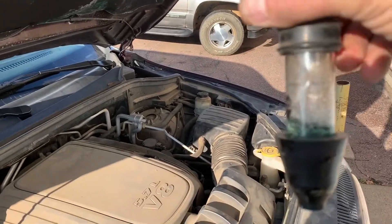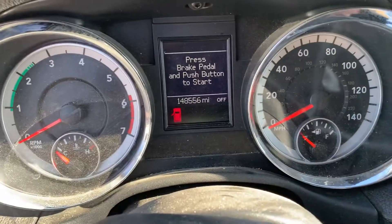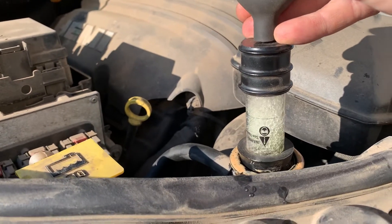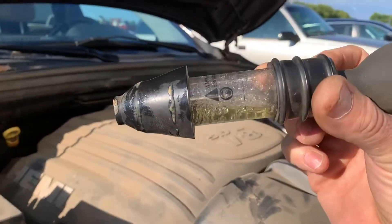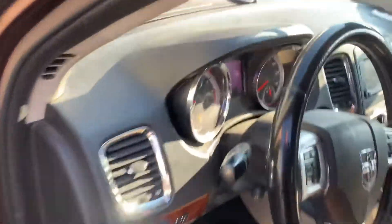That's turned an icky yellow — that's not good. We're going to fire this thing up. It's got 148,000 miles on it. The engine's fairly quiet. What I'm looking for now is to see if this fluid will turn an even brighter yellow once it's running — and yeah, now it's definitely yellow. There are no exhaust gases blowing directly out of it while it's running, though some are so bad they actually will just blow right out of there.